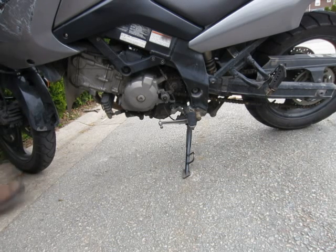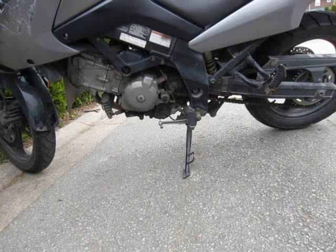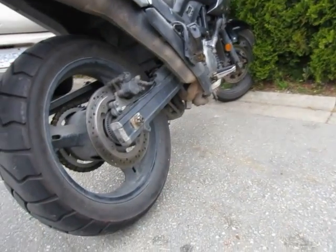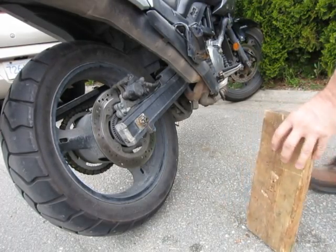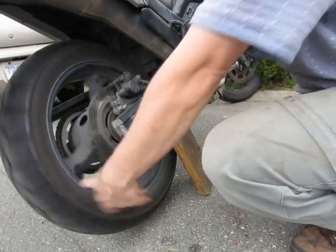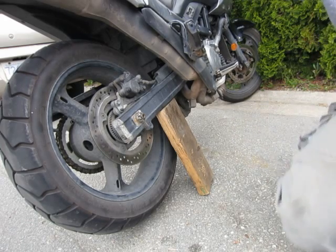You can push the front wheel against a tree stump, the side of a pickup, a big rock — whatever you find. But the front wheel mustn't roll forward because the bike doesn't have a handbrake. If the bike rolls forward when the rear wheel is lifted up, you're going to be one unhappy camper. So you grab your two-by-four or two-by-six, lift up your bike just a wee bit — just a pencil gap underneath the rear wheel — put the bike in neutral, and you can do your chain maintenance.